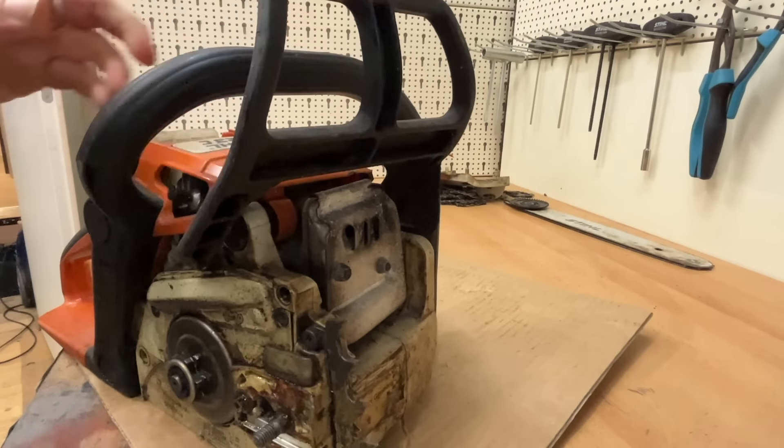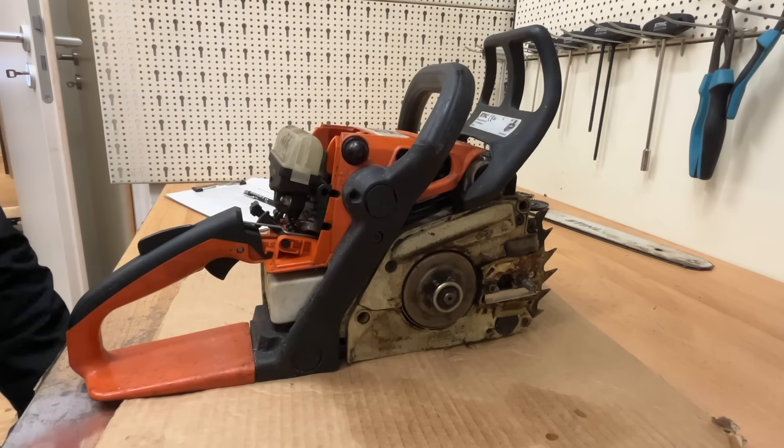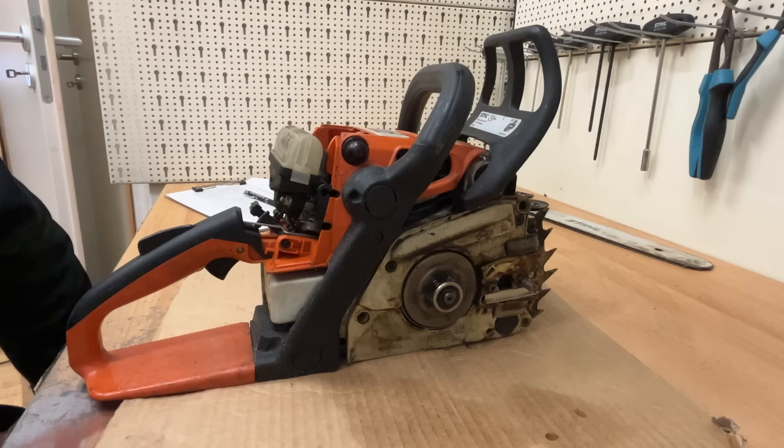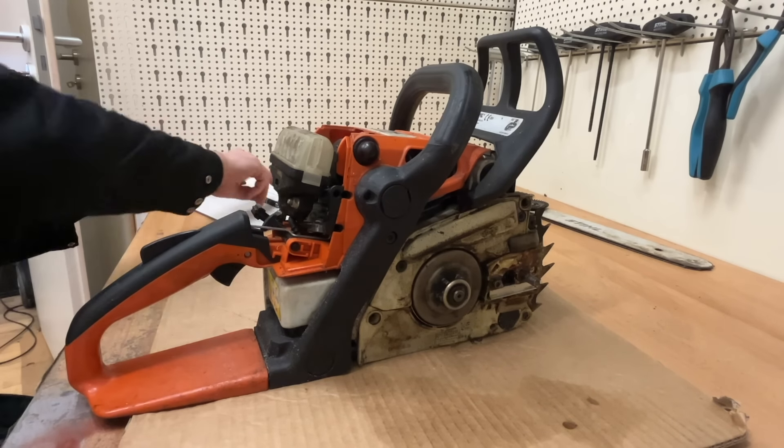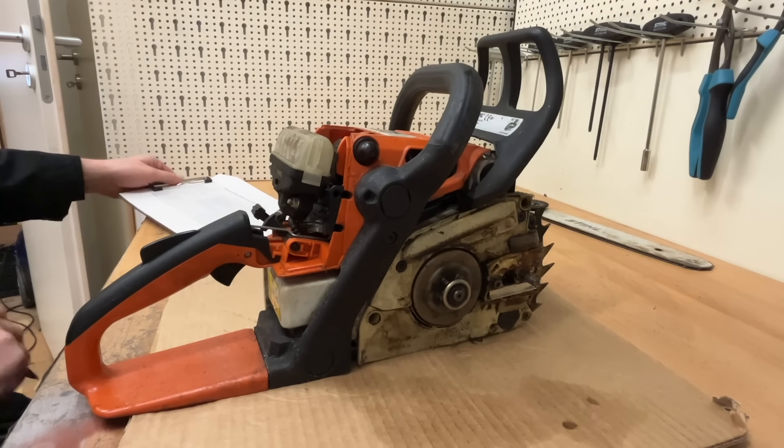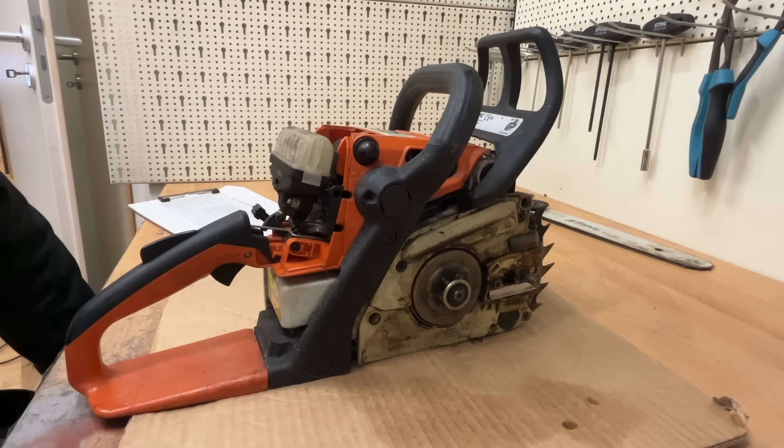What I just noticed: I pressed the muffler with my fingers because the thing is quite loud. I assume the muffler gasket is already damaged. You can also see that the baffle plate at the front of the muffler appears slightly bent — maybe the previous owner wanted more exhaust gas to escape. So what I can definitely show you now is how to properly adjust a carburetor. Additionally, we'll do a small inspection since the sprocket is defective and the air filter looks terrible.